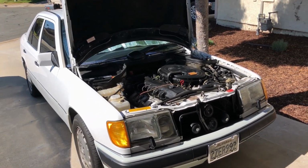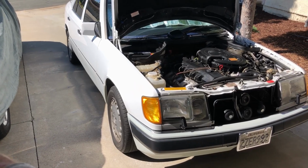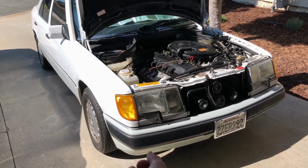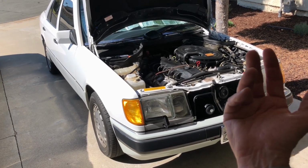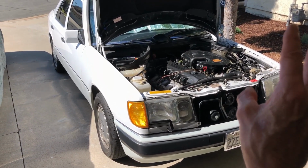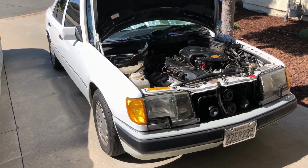Don't do that. Why would they do that? I think they were taking the climate control unit out to work on stereo stuff, and they disconnected those connectors and all those wires just popped out and they put it back wrong. That's the only explanation, because there's no way it would have left the factory like that. I mean, they test every function in the car.